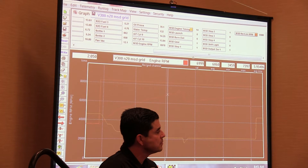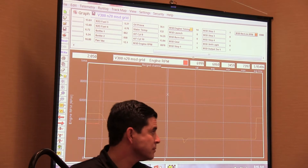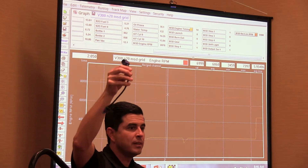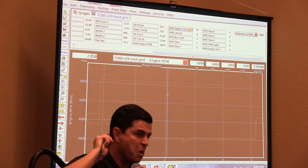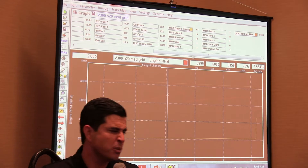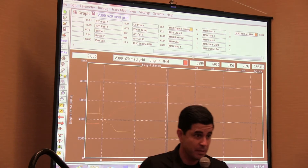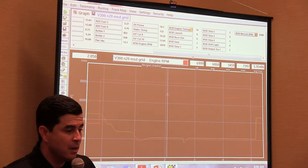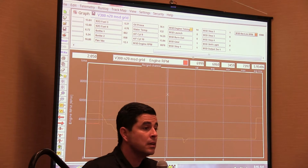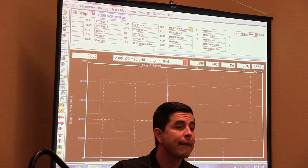Your box makes spark, and then the Power Grid brain unit is what controls all of that, and then you can send all that information to this. They're coming to the point where MSD 6ALs and stuff — they're going to start phasing them out. No, that's great for performance hot rod vehicles. The 6ALs — I believe they make the digital boxes of them now. They have the digital version, but to my knowledge the 6A or the 6s are not going anywhere. They just have a digital version of it now.